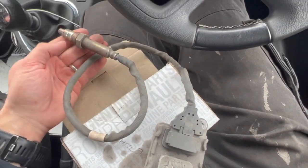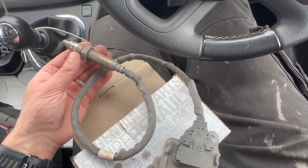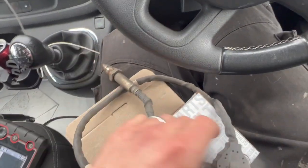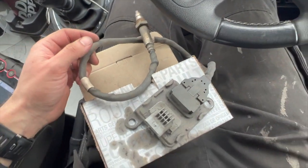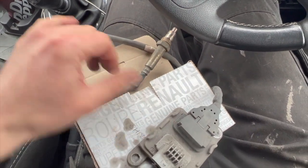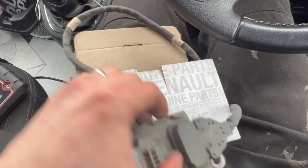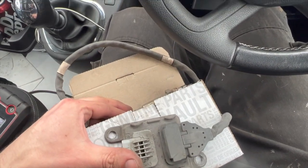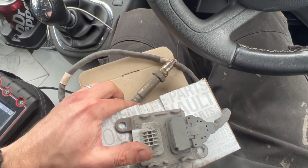This is becoming quite a common issue so I thought I'd put a video together on it. This one's NOx sensor 2, but you can also have issues with NOx sensor 1, the one that sits just behind the DPF. They're hard to fault visually — they seem to just pack up in the ECU section itself. Always replace with genuine parts, as I've heard of a lot of people having issues with aftermarket ones. They are quite expensive units, but I've put links to the part numbers for both sensor 1 and sensor 2 in the description below. Hope you liked it — give it a thumbs up and subscribe to the channel.